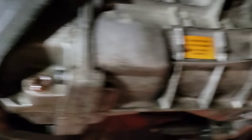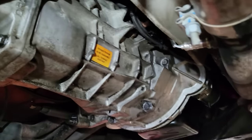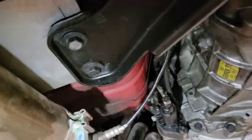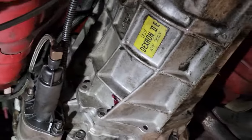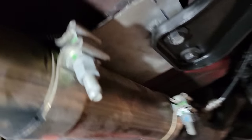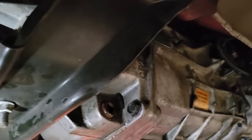We've got her buttoned all back together. Drive shaft's back in, cross members in — it wasn't actually too bad. Once we put the new clutch and the bell housing back on, it just slid right in, no problemo. That is definitely the way to do this one — leave the bell housing on, take the transmission with the bell housing off together. We've got the slave cylinder back in, all the bolts are in tight — not loose like when it showed up. And we even put an aluminum plate in between those fuel lines and the brake lines and the exhaust, to isolate the heat from those. We don't want to be boiling the brakes or the gas.